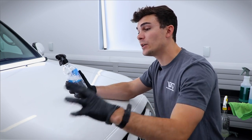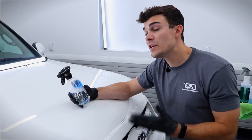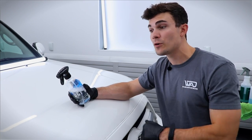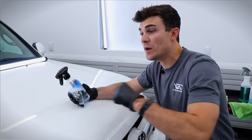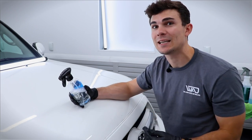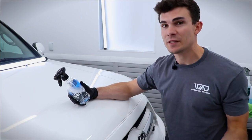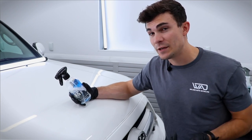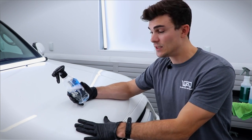If you didn't know that water spot remover will remove this stuff, it can be so difficult that a lot of detailers spend literally an extra one, two, or three hours just taking their wash mitt with car soap and scrubbing one panel at a time because they don't know there's an easier way. It's just a really difficult substance. So if you're in the Southeast or other parts of the United States, this is probably something you're dealing with. That's a very easy way to get rid of it — a fail-safe product for miscellaneous buildup on a car that's been sitting outside.